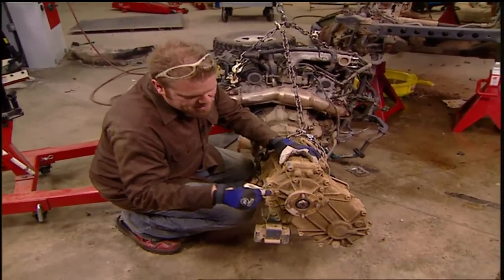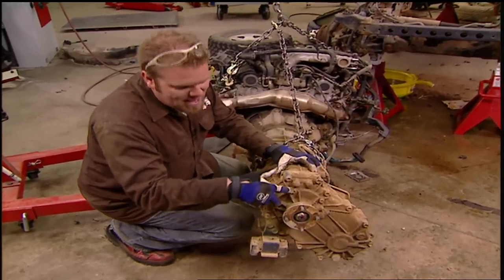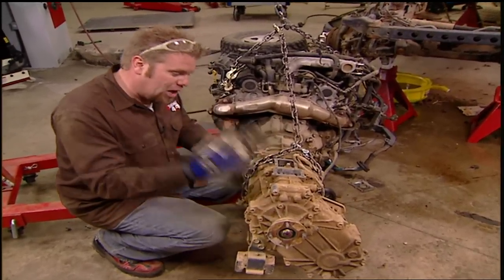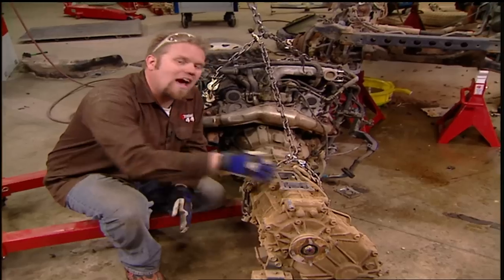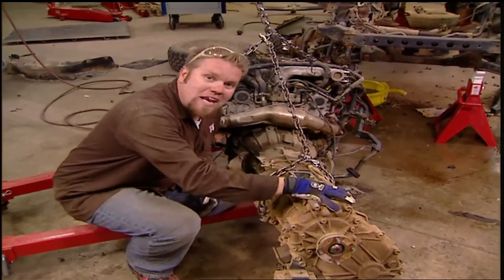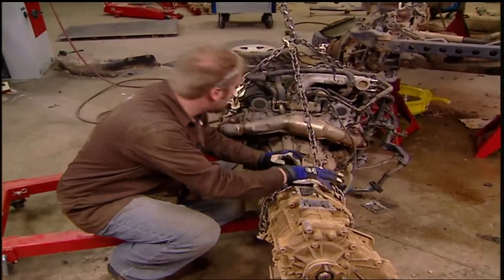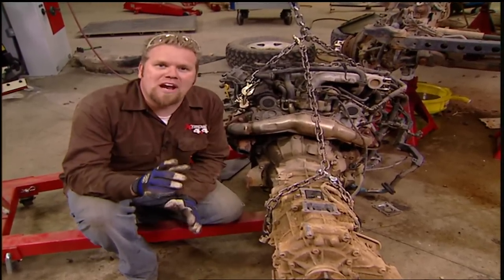It's easy to tell them apart because the back cover on a gear drive has seven bolts; on a chain drive like this, it has five. If we had a gear-driven unit, it would be worth keeping the back half of this drivetrain because we could double it down and get a lot better off-road use. But with something that's weak here, something we don't like here, and this thing being broken, the best thing to do is replace the entire drivetrain.